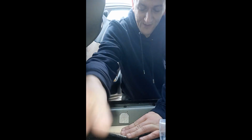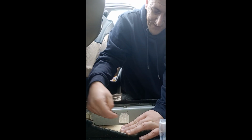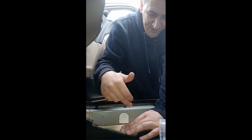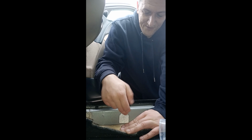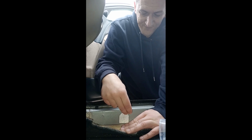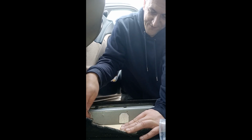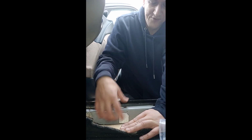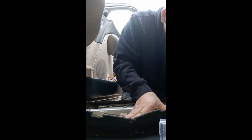Believe it or not, there's various ways that you can get wax into the sills. So, move the camera. So there, this is just a little bitumen pad. You can actually put a hole into those, or you can just take them back off. Realistically, we do that so we can actually get access to the inner sill section, so you can get all this area cavity waxed, which is just a form of protection at that point.